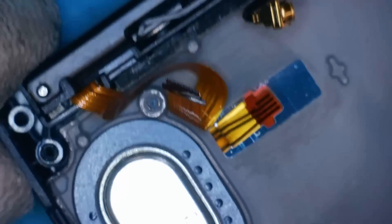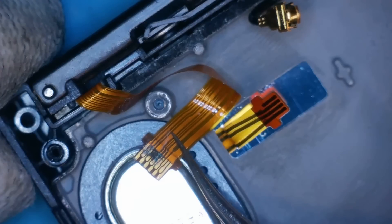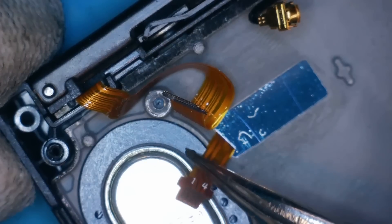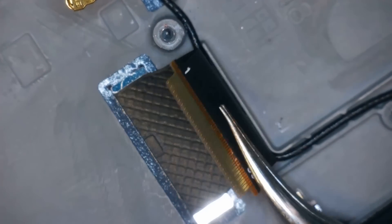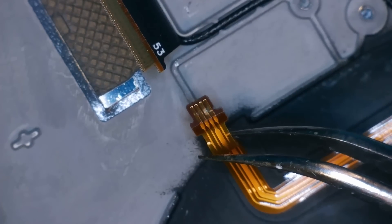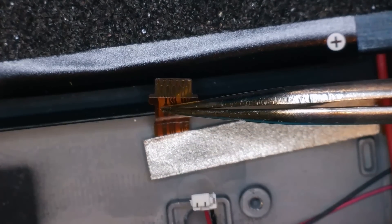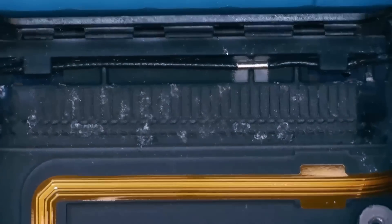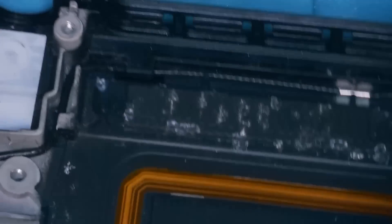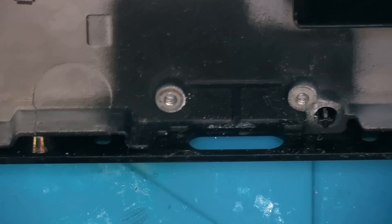I've taken the motherboard out, but I want to note one thing — I think we're in a bit of trouble. Look at the state of this ribbon cable for the right Joy-Con. The backlight connector and the LCD connector seem fine with no liquid damage. I think we have a small bit on the power and volume buttons ribbon cable. The left Joy-Con rail ribbon cable also looks absolutely fine. I'm trying to find evidence of where the liquid came in — there's a little bit visible on the left, and maybe a little bit down at the bottom as well.